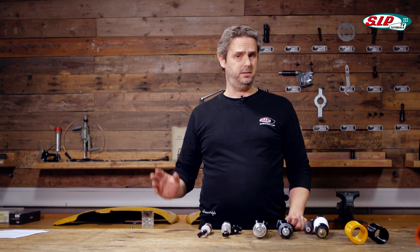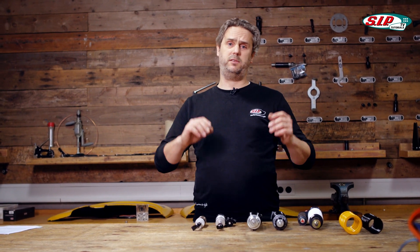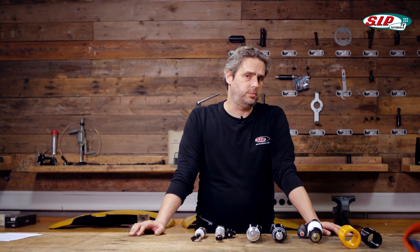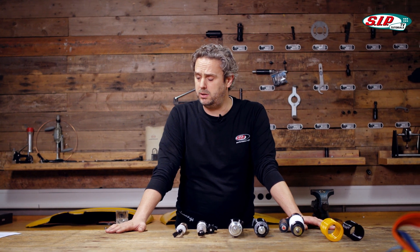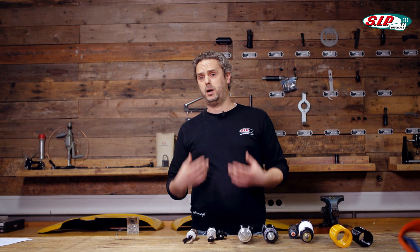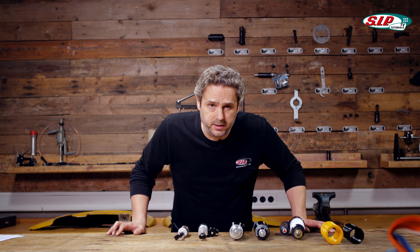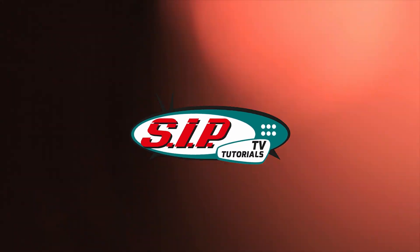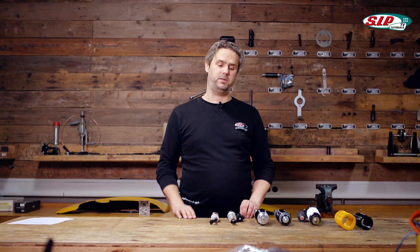I hope you enjoyed this video. All the adjustment options on shock absorbers are not that easy, and there is no guidebook available to adjust the chassis correctly. The basic setting can be done relatively easily with a little accuracy and thinking. Very important: hard doesn't always mean sporty. The important thing is that the tire is always pressed evenly on the road — if your chassis is set too hard, you usually have poor road contact. Please don't overdo it, but otherwise have fun adjusting. If this video helped you, please let me know in the comments and share it with a friend who could use help too.